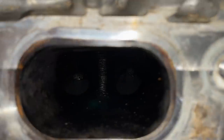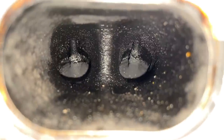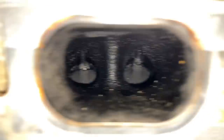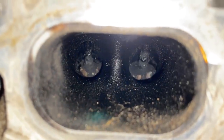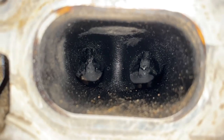I guess the cleanliness difference has something to do with how the PCV recirculates through the system. Cylinder two is again not quite as bad — very visually different to the other ones. And in cylinder one you can actually see the most raw metal on the valves, so cylinder one is actually the cleanest of the lot.